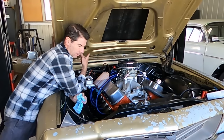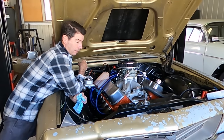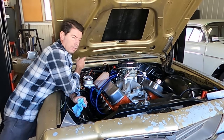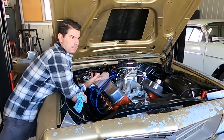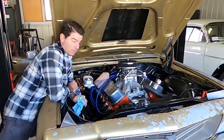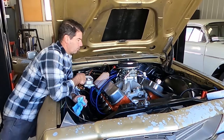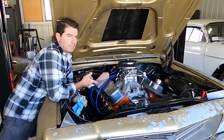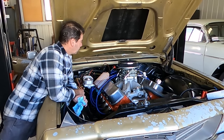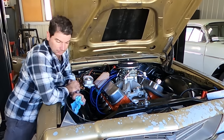So now the only way I'm going to make it better is actually to start it and get the transmission to pump fluid into the cooler and into the converter, which empties the pan, so I can refill the pan. So I think it's time to start it, which shouldn't be an issue, because last episode we started up, broke in the cam and lifters. Well, the lifters, the cam wasn't brand new. So I guess I'll just add some spark and see if we can start it.